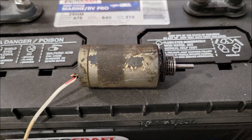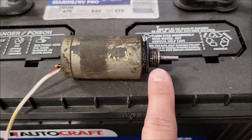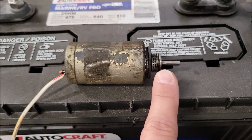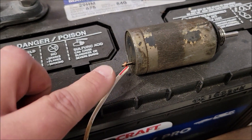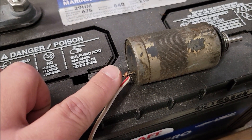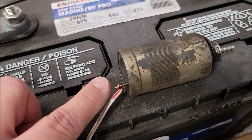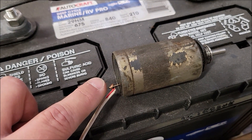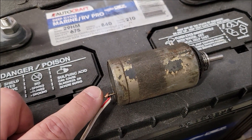On this specific fuel injector solenoid, the unit itself is the ground. So once you screw this solenoid into the fuel injector pump, it automatically starts to be part of the ground because it's attached to the engine. All it has is a single prong sticking out the back, and this prong is wired into the ignition of the skid steer. So when you turn the key, you should hear a click — though in this case you won't because it's pretty buried down into the engine away from the cab. On my John Deere, I hear it right away when I turn the key.